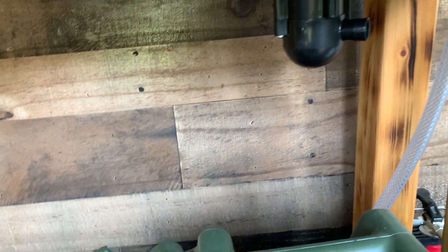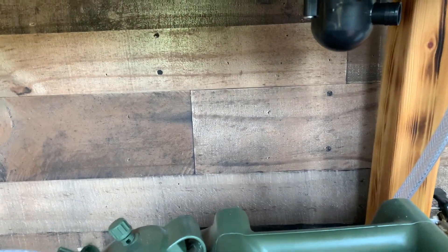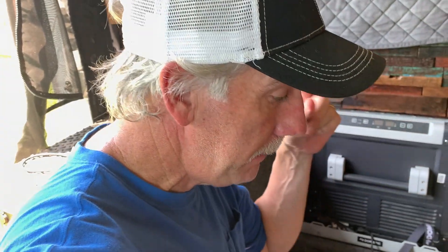The gray barrel drain hose is going down and coming up through this hole here — I'm going to open that up. So this five-eighths hose will go down through the floor. Then I can put the gray barrel back in and get this plumbing done finally. Then we'll move on to the next thing. Oh, I also have to hook up the pump — so after I get the gray barrel and the sink hooked up, next will be the pump. Wire the pump up and get some water going.